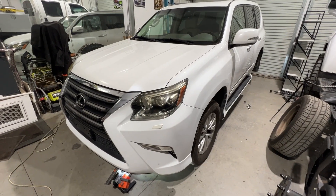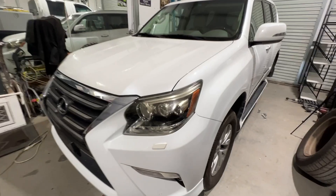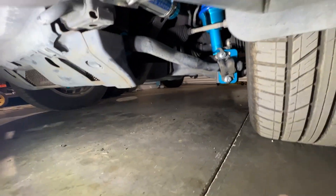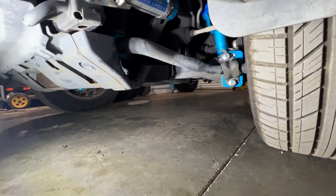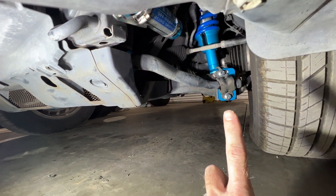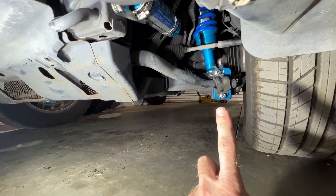We got the front buttoned up. I didn't want to show you guys a repeat on the other side, so I just went ahead and knocked it out. But if I get under here, that is from Dr. KDSS and it's for the KDSS sway bar system. We also did — if you can see the blue right there — the collars to keep the sway bar in place. That's something you really want to do when you lift these Lexuses and 4Runners with KDSS.